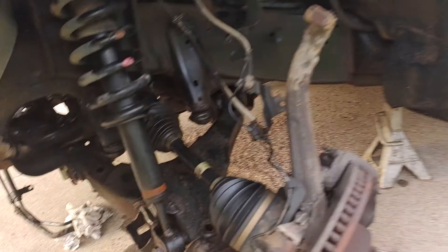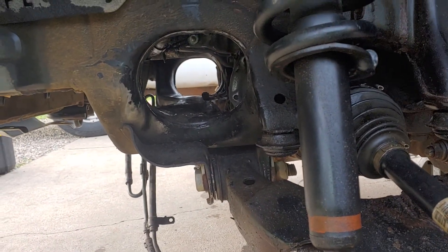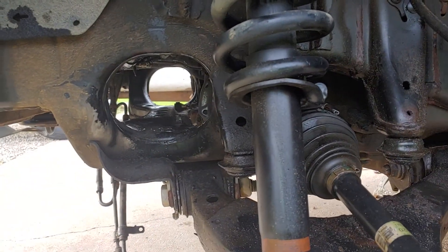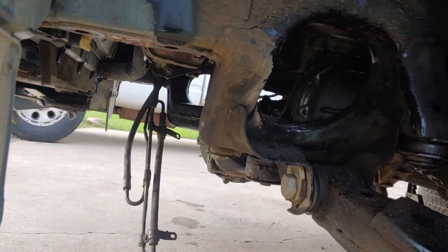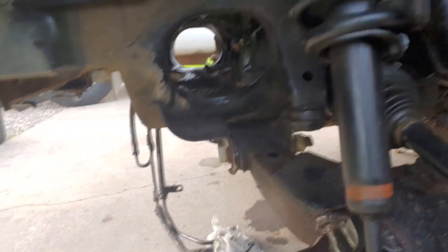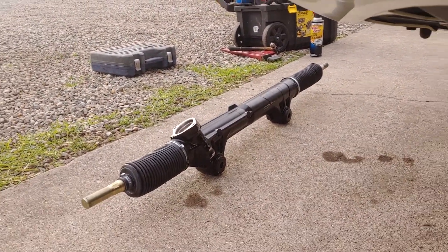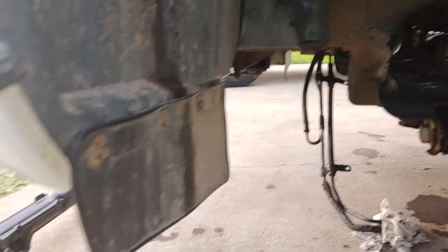That's going to make it so it fits right through the hole. I just fit it in there and it went like gravy, so that's going to be key to getting this thing in there. You might not even have to take the oil filter off if you do it this way. Just make sure you keep everything clean. I had to take the gearbox off and I measured the tie rod end lengths so I could put it back on in the same position.